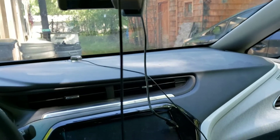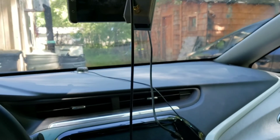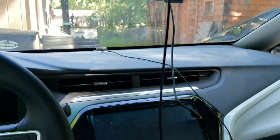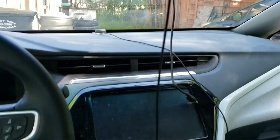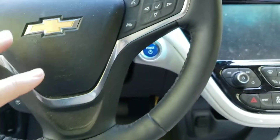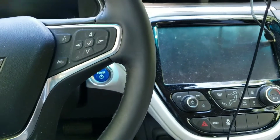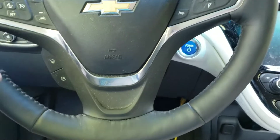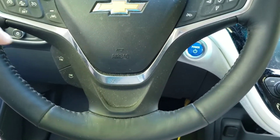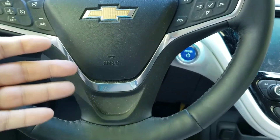I was really hoping I wouldn't have to run a Cat 5 cable up there, and we still don't have to. Under the dash there are plenty of locations where we can get an unfiltered powertrain bus. If you're out of warranty and feeling frisky, you can just run a pin through those wires and tap into them. But you'd be leaving evidence of having modified your car — dealerships don't like finding pinholes in wires, and moisture could get in. I can think of reasons why that's a bad idea. I want to find something under the dash I can tap into, and I have a 3D printer so that's not going to be a huge problem.